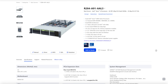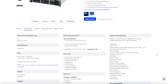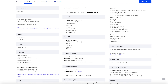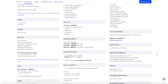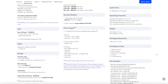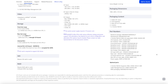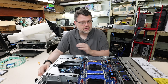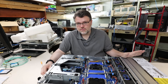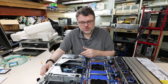I love this chassis design because it gives you, the system architect, the flexibility to do whatever you want. If you have too much CXL or PCIe connectivity at the front, you can use your MCIO headers and reroute those PCIe lanes to the back. You don't need a different motherboard or a different SKU — you can just mount another x16 slot at the rear for whatever peripherals you want.